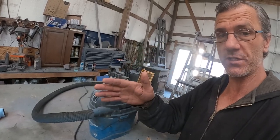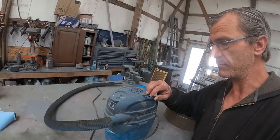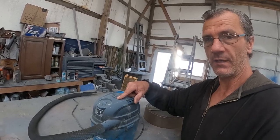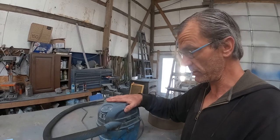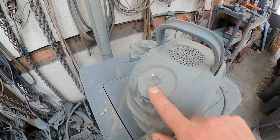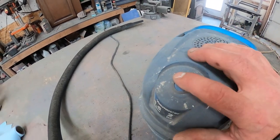We've got this vacuum — a couple of these, they're only 15 or 20 bucks — and they actually last really well and do a good job with the stoves. But the first thing that happens is the switch goes out. I've already replaced the one on the shop one, and this is one that goes in one of the houses. We use it only for cleaning out pellet stoves and this switch is frozen up — it was smoking when it happened. I'm going to tear this apart and put a new toggle switch in it. The toggle switch would be worth half of what the whole vacuum is worth, but that's hardly the point. The point is it works good — it doesn't need to be in a landfill.